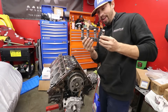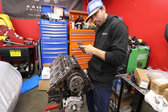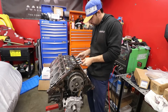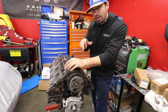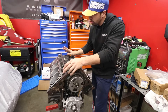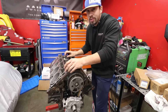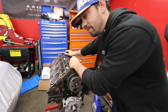We're going to put our genuine Hellcat lifters in — probably the fanciest part of the build. These lifters are definitely different from LS lifters in the fact that there is no side oiling hole; it gets all its oiling through the push rod, which I find a little weird. That's probably part of the valve train oiling issue, because there is a big one in the Hemis.